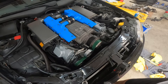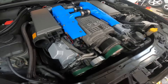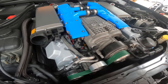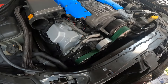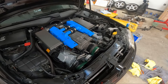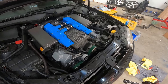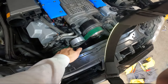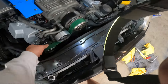Okay, that was a fight. I believe the belt that's on here right now is kind of a perfect fit, and raising up the supercharger by whatever it was — not even a quarter of an inch, maybe an eighth of an inch — was just enough to make that thing pretty tight to get on. We might have a need to adjust our belt size once we put the 80 millimeter pulley on, but I think it's okay right now. It doesn't feel too overly tight, but definitely tight, so hopefully we don't get belt slip with this setup.